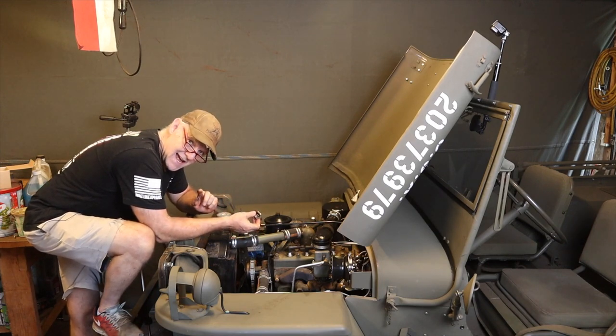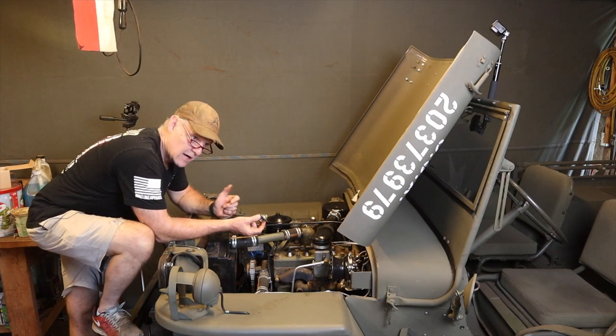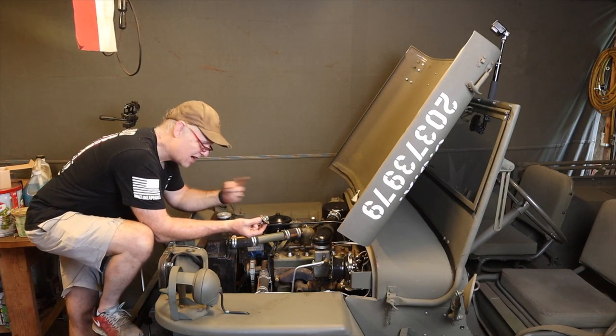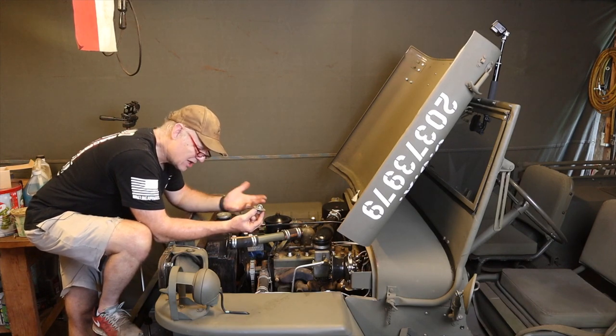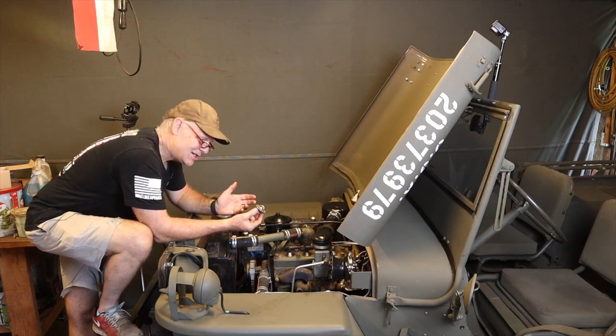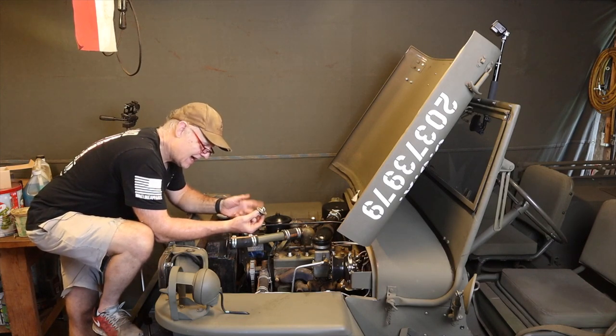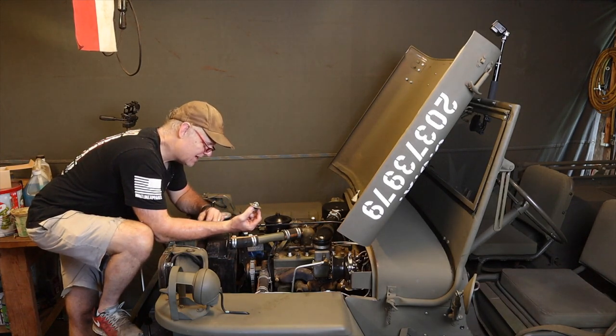And what I expected to have happen was that the temperature should decrease very rapidly down below 160 because it's now just circulating constantly. And so if everything's in tip-top shape, it certainly should be down below 180. And it didn't do that, which tells me, again, for some reason, nothing was circulating. So we now have, you know, a couple of potential causes.